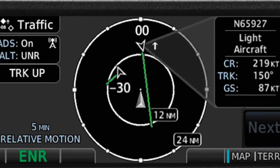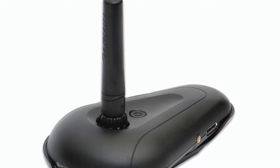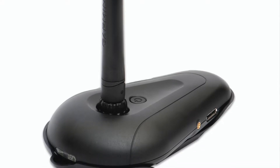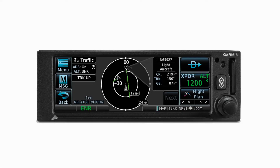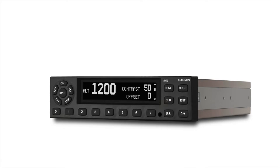There's also a comprehensive traffic interface, and there's a long list of compatible Garmin devices to select from. This includes the GDL 39 series portable, the GDL 50 series portable, the GNX 375 ADS-B transponder equipped navigator, and the GTX 345 series ADS-B transponders, all of which have wireless Bluetooth. Wired interfaces are connected with the optional Garmin Power Data Interface cable.